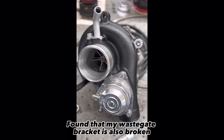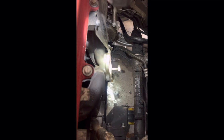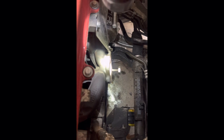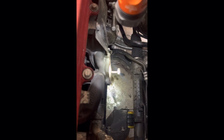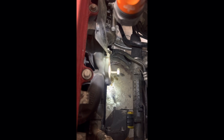After that I gotta get the broken bolt out. Sadly, a stud broke, which I'm not very happy about. Thankfully a co-worker had smaller twist sockets than I did and he was able to get one on there. We just used my mini torch, heated it up, and it twisted right out — thought I was gonna have to drill it. The only one that's left has boogered threads on the end, so I'm just going to clean those up real quick.